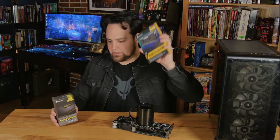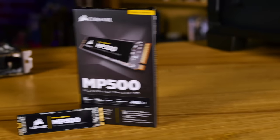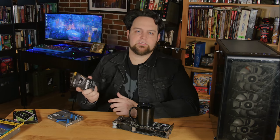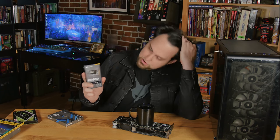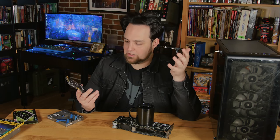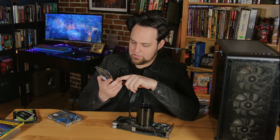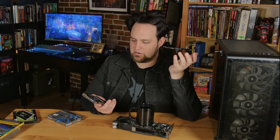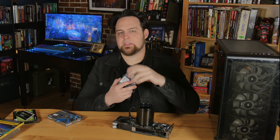For M.2, you've got to have an M.2 with a system like this. This is the Corsair MP500 240GB and I'm using it for the OS. It's not a huge drive but it's really fast, so boot times are going to be instantaneous. It's 3,000 megabytes per second on the read — that's absurd. The write is as fast as the read on my current M.2, and it hits 250,000 IOPS.